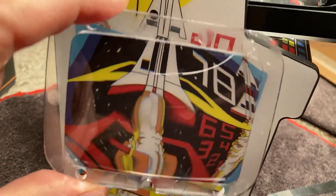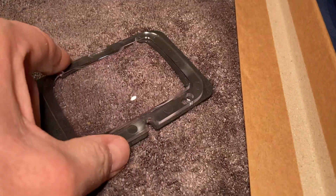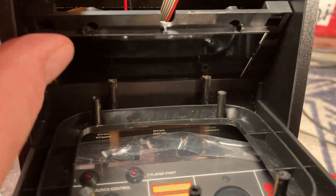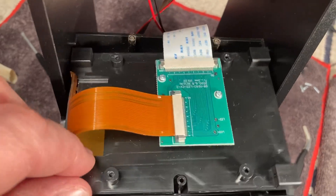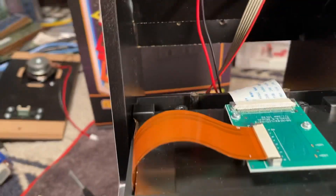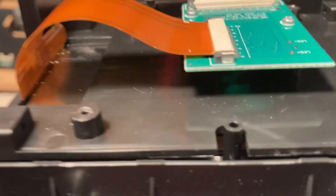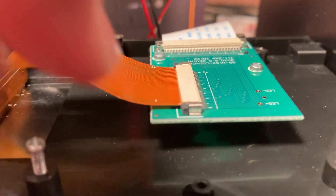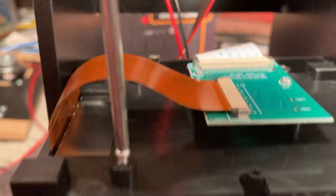I'll use the artwork as an example - you can see how the lens distorts the image. This is what some of you don't like, so that's why I wanted to do this video to show you how to remove it. These two pieces I won't put back in. Next, reach back in here - be careful not to get any fingerprints on the LCD - and lay it right back on top of the bracket. Center it back on the pins and it'll drop straight down, then we'll put the screws back in. I'm only going to put one back in for right now because there's something else I want to do later.